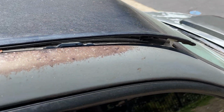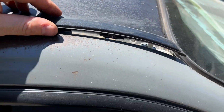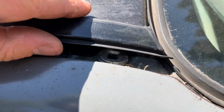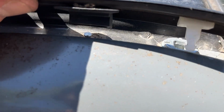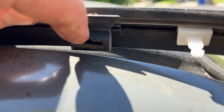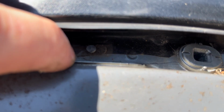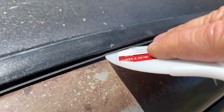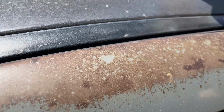I know I covered it in my other wrap series when I originally wrapped the car, but this is how you basically get these roof rails off. It's just this little clip that goes in the hole. I also have one of these little sliders, notches into the nub right there. But in my case, my car is pretty worn out, so I don't really have much that are locked on. You feel one and then you would slide it forward, and then essentially it would unlock from the little nubber there. So that's just a real brief rundown on how to get it out.